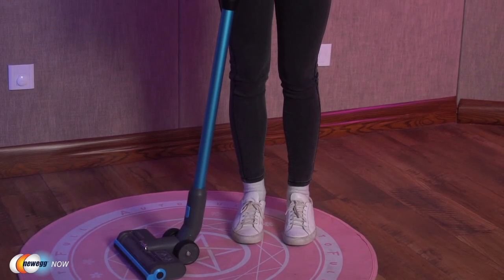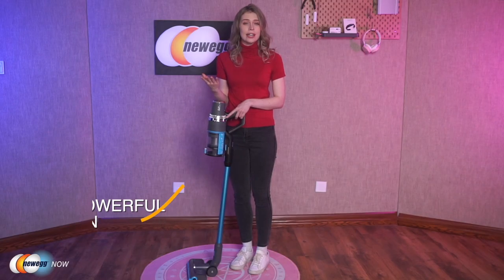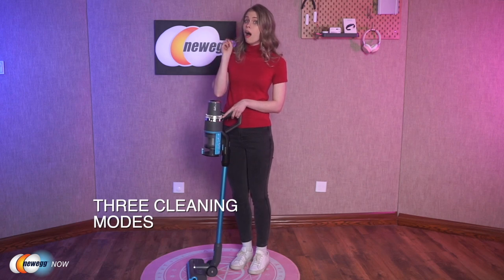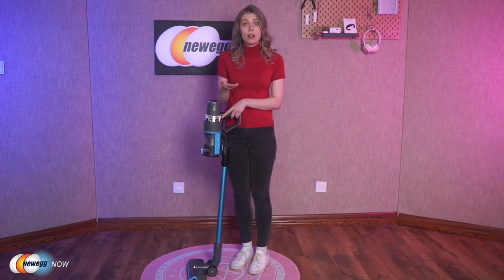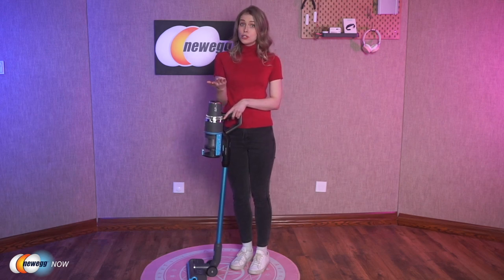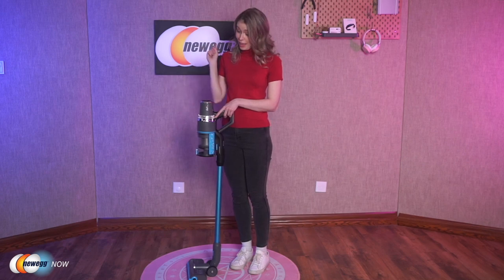The Jashen V18 Cleaner has extremely powerful suction. Its brushless motor provides ultra-quiet, powerful suction and can detect hidden dust when equipped with the dirt sensor. It has three cleaning modes: min, auto, and max. Intelligent auto mode is recommended as it can adjust the power from 150 watts to 250 watts to 350 watts according to the situation, and the running time is about 40 minutes under normal circumstances. You can also choose minimum mode for only 115 watts power, or maximum mode for up to 350 watts power to meet different needs. Be aware — max mode can only last 15 minutes, so if you have a big mess that needs cleaning, I hope you have an extra battery.